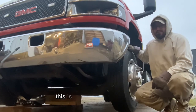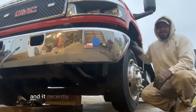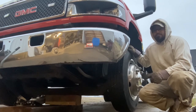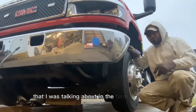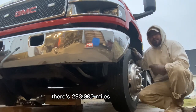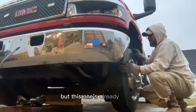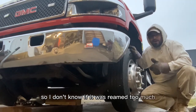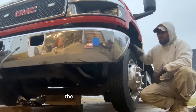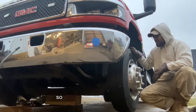So that brings me to this one. This is a big ol' roll-off wrecker and it recently had kingpins done by the local spring shop I was talking about in the farm truck videos. There are about two years on this set of kingpins and 293,000 miles on the truck. This one's already loose — I don't know if it was reamed too much or didn't get enough grease — but it's already worn. The other side feels tight, but my job today is to replace both sides.